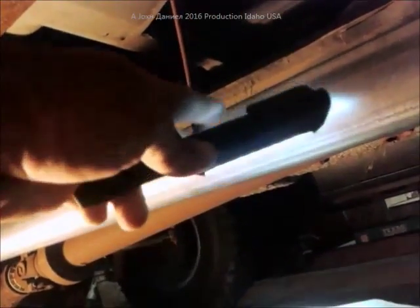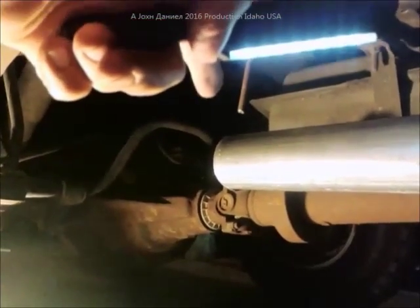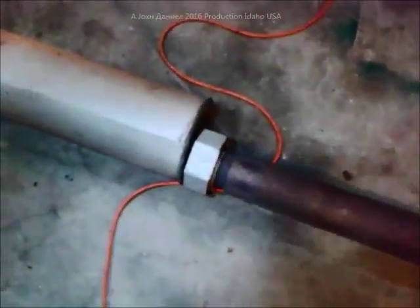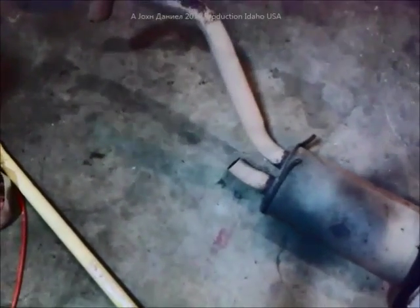This is all three inch coming out. The muffler hangers are on the side and can be bent back in to mount this muffler, which is a straight-through muffler with no heavy baffling. You'll cut away those two hangers up here and weld a flat piece across - that allows you to use one of those small hangers that'll hook up to your clamp. Cut this muffler completely out - it's an odd-size resonator that is really restrictive, immediately going to a pair of inch-and-a-half OD pipes.